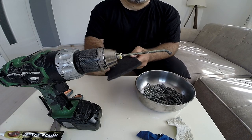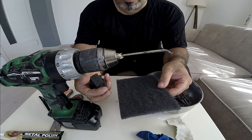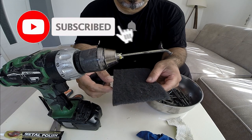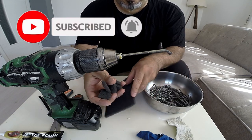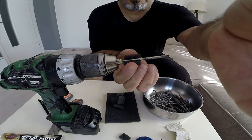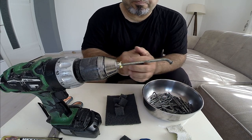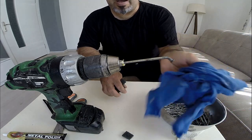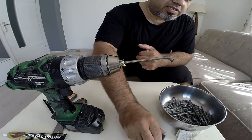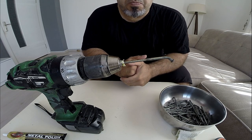You also need some steel wool — this kind of stuff that they use to clean up surfaces before sanding. It works great, and it's worked well for me on my front spokes for the Yamaha V-Star 650. You cut them up into little squares so you can put a piece around the spoke and work your way up and down to get it all nice and shiny. And you need a rag — a cleanish rag — so you can wipe it at the end to see the end product. That's basically all you need.